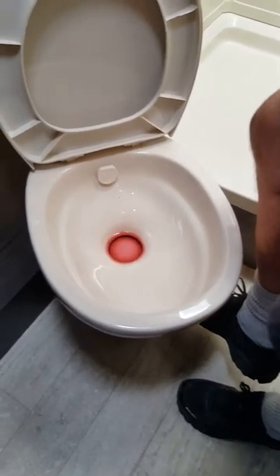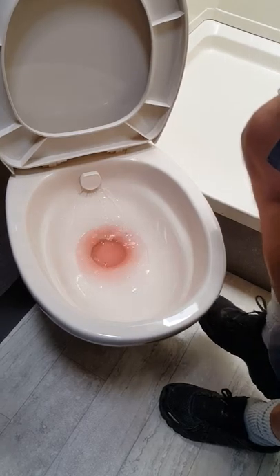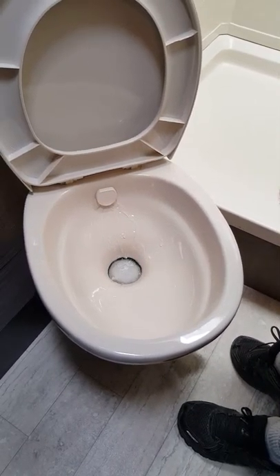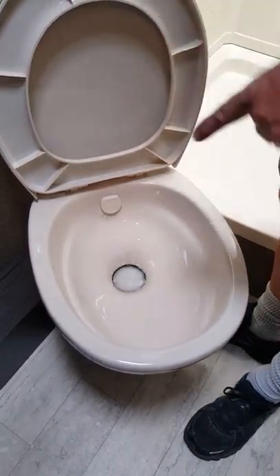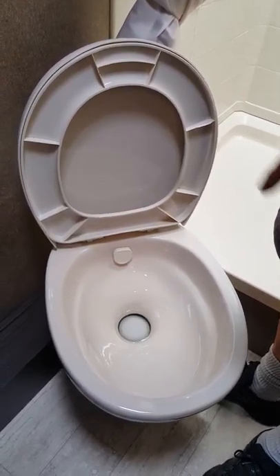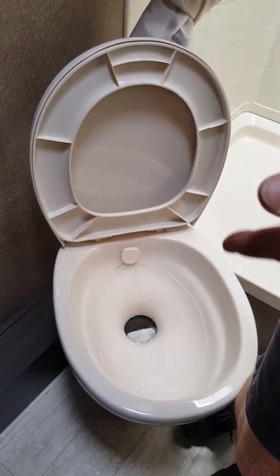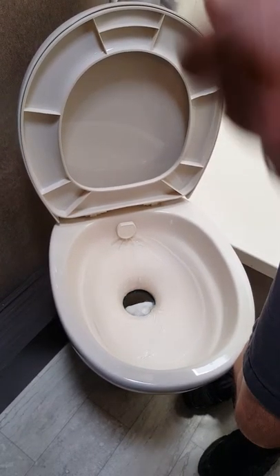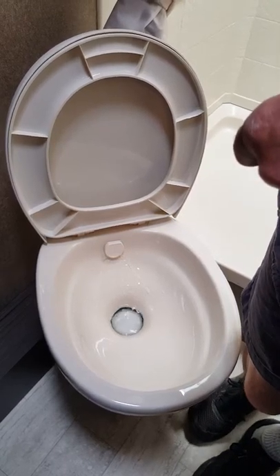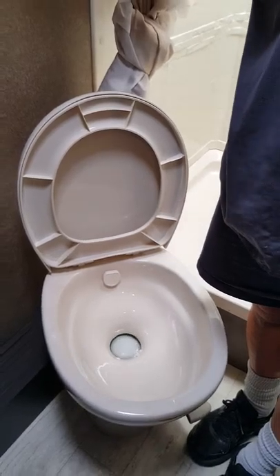You have hot and cold on your shower handle with an on/off. For the toilet, push the pedal halfway down to fill the bowl; once you're done push it all the way down to rinse and flush. Put chemical in the toilet before you use it — first put about a gallon of water in by holding the flush for 10 to 20 seconds, then pour about four ounces of chemical or use the packets. That keeps the smell down and breaks down the paper.